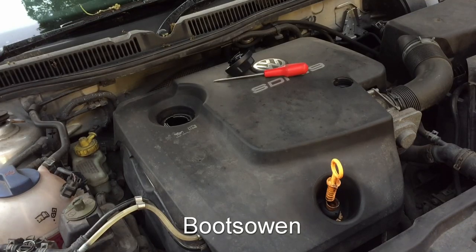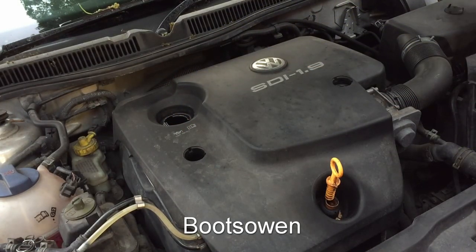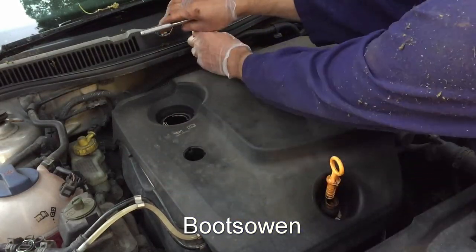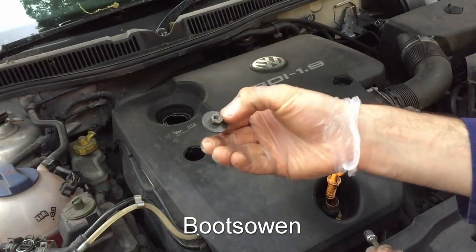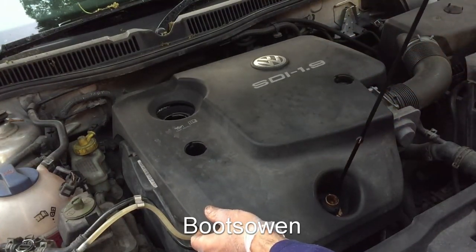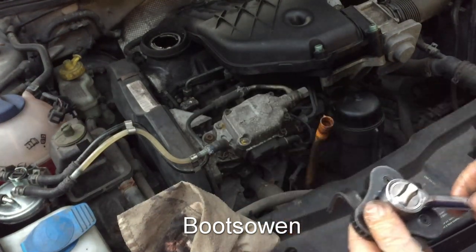So while the oil is draining off, I'm going to do the filter, which is in under this cover here. I'll take off that cap and just set it aside. It should have three little covers like this, but on this one there's only one cover. Snap that off with a screwdriver. And then in there there's a 10mm nut. The cover on the back one is missing, and this one's just missing completely. So take out the dipstick, give it a clean, set it to the side. Then that should just lift off — and it does. This is an oil filter wrench, but you could use a strap wrench or something like that.